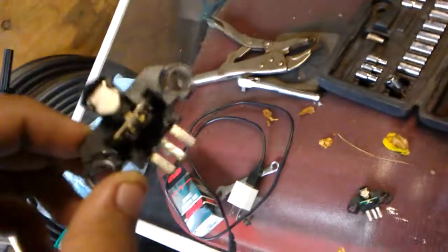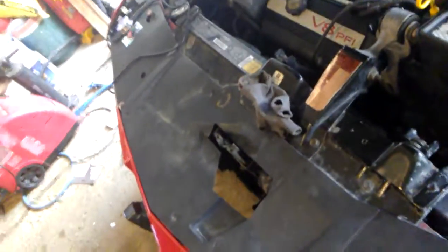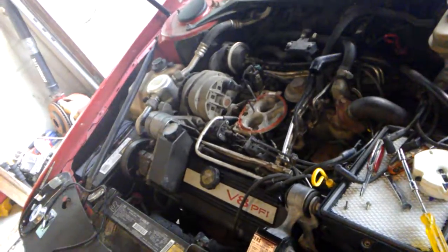Today's a sad day. This little sensor right here — this is a hall effect sensor and its job is to regulate which cylinder is about to fire, so it knows how to evenly distribute fuel. Right now this thing is basically running like it's got TBI, not PFI, which isn't bad, it's just giving me terrible fuel economy. Anyway, I bought the new one right here.